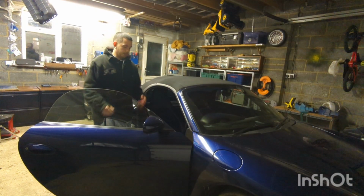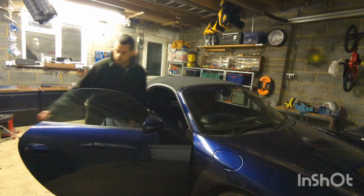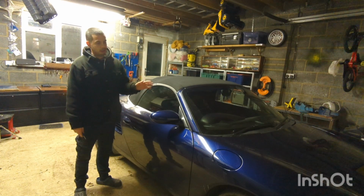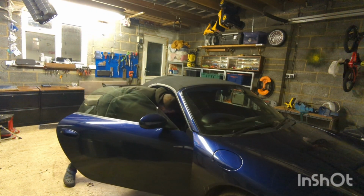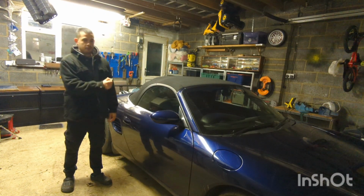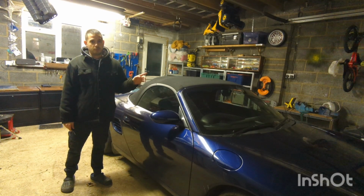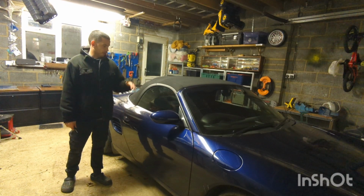Your car will beep at you when locking it on the remote if something is not shut. So, demonstration. Everything's shut, including the glove boxes, all of the boot, bonnet, everything down. Lock the car, no beeps. Unlock the car. Just open the centre dash console glove box. Lock the car. There's your beep. That's telling you you have not shut your glove box properly, or it might be one of your compartments is open. So if you get that beep, that's all it is. Go in, make sure that's closed.